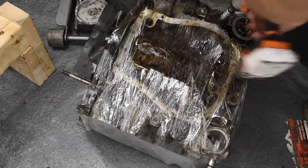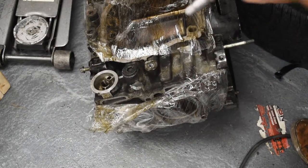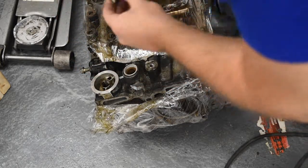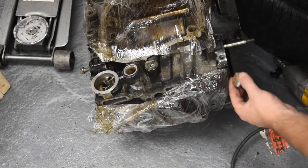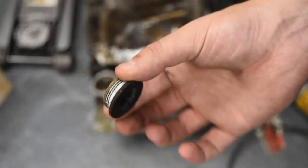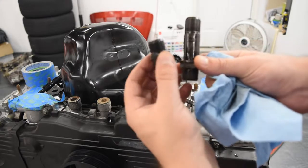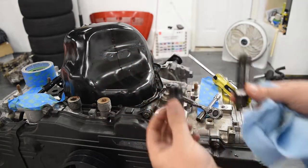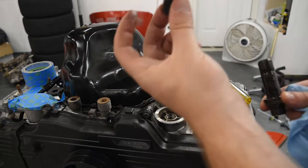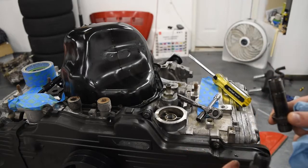And now we'll also steal this coolant plug. And now one of the key things is these bolts. So this is the naturally aspirated one. This is from the turbo, and it needs to be longer for that clearance for the oil cooler. So this is the trick from the naturally aspirated motor to get the shorter clearance. I don't think I'm going to need the oil warmer. We'll just let the oil warm up.